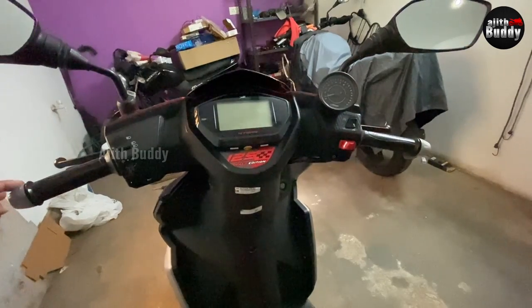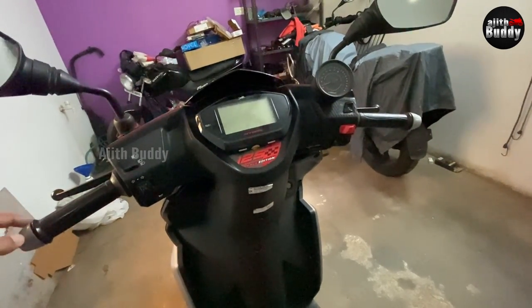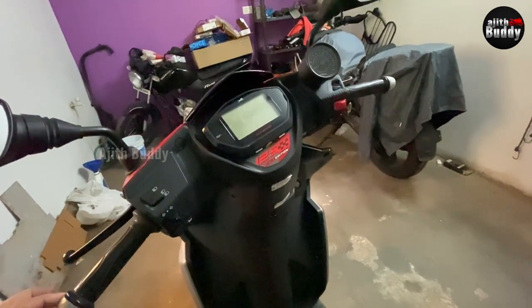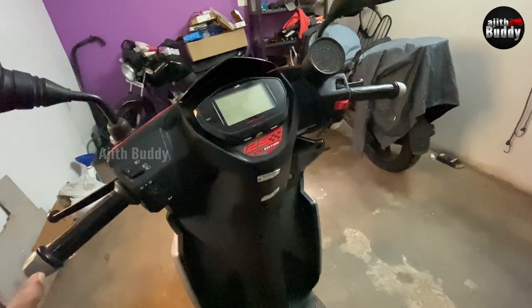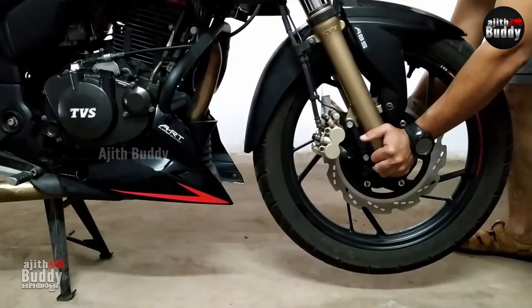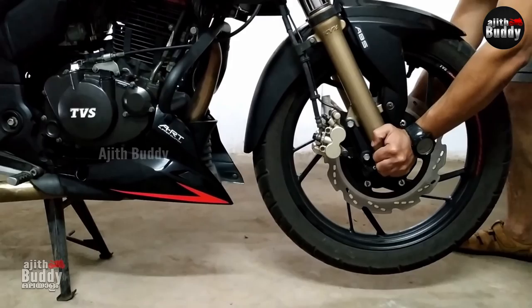As you can see, the front wheel is raised off the ground. When it comes to the middle, it is like landing in a pit. You can clearly feel that it is very difficult to get over that pit and turn to both sides. This is the easiest way to identify if it is damaged. It can be understood immediately if the cone is tight.